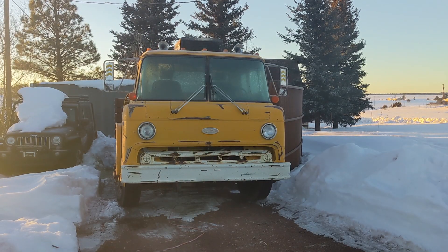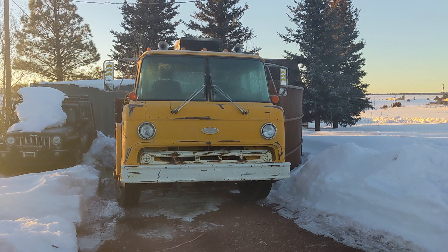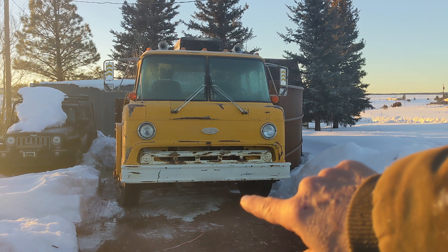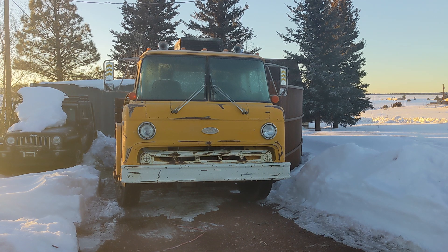Good morning. It is 21 degrees out here, and you can tell the truck is cold with all the frost up there. This is an old Caterpillar 3208 — it does not have glow plugs or any kind of a heating element on the air intake. There's a little green light down there; I've got a little weatherproof timer plugged into an extension cord and the block heater. It's 7:20 or so in the morning, 21 degrees Fahrenheit. We're in northern Arizona, and that block heater came on at 5 o'clock, so it's been on for 2 hours and 20 minutes.